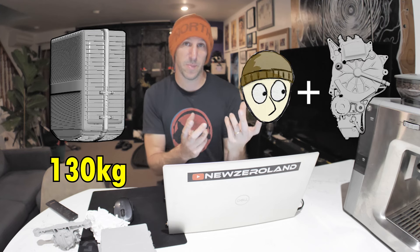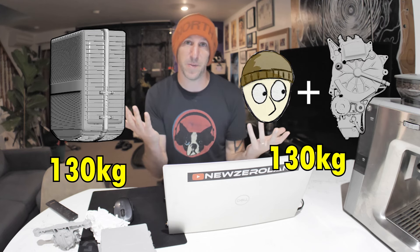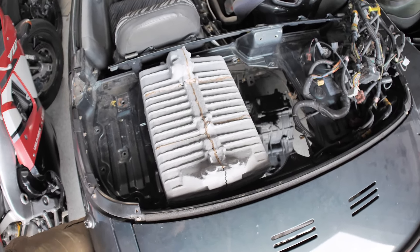And this is how I wanted it originally, because it's 130 kilos worth of battery and then me plus the motor — also 130 kilos. So side to side balance would be perfect, aside from the diff, but the diff is kind of in the middle a bit. I'm so excited because all it's going to take is cutting a little bit of that frame piece and reinforcing some stuff with a big bar. I can even keep my trunk.